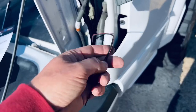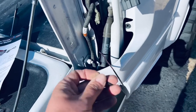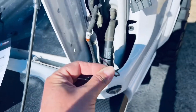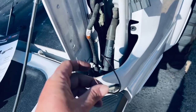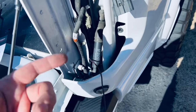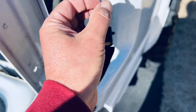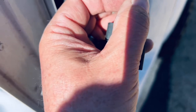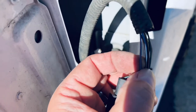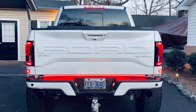Got my wire run up through here. This is a green wire — I extended it with some wire I had. It's the green wire from the MC Tuning kit and that is the passenger turn signal. I looked on Google to find all my wire color codes for the Fords. A blue with orange stripe — it almost looked pink but it's orange — blue with orange, that's going to be our turn signal. All right, put your foot on the brake.